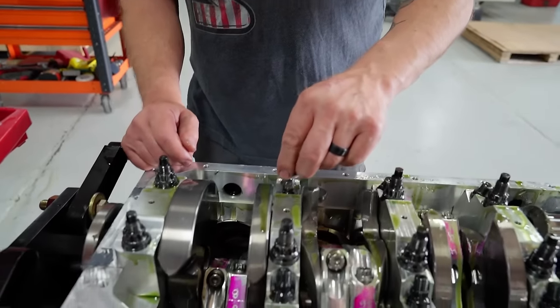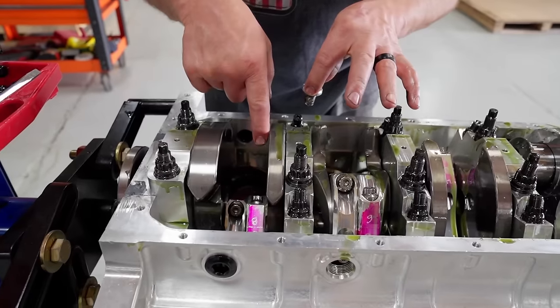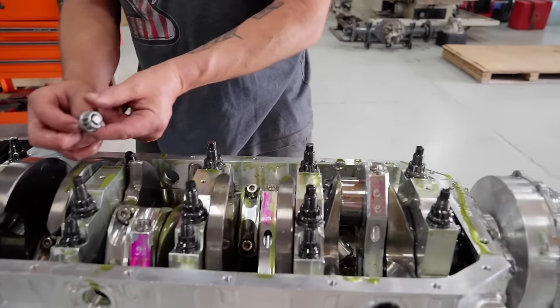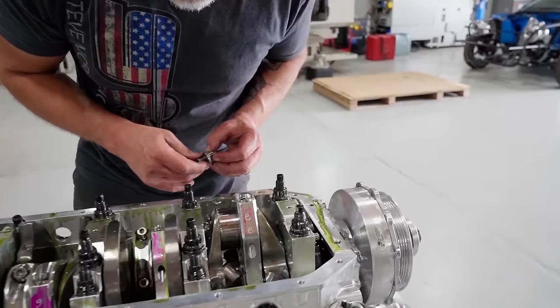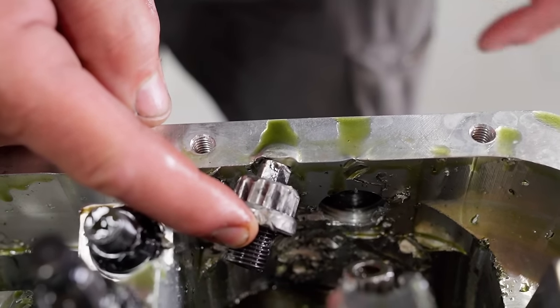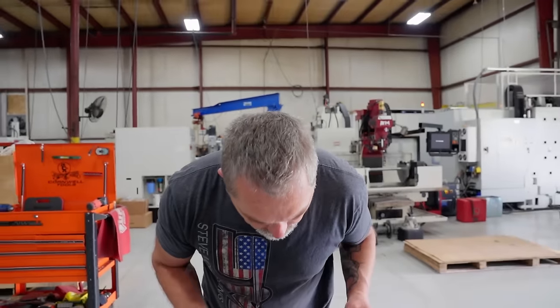But when this broke, very interesting that it didn't destroy stuff back here. It actually moved forward. So that's telling me that it probably did the burnout, and when I hit the brake, you stop after the burnout, it goes forward, whoosh, boom, boom, boom, boom, boom, boom. And literally there is one spot in here in particular where it just fits right there in the pocket. Well, where is that aiming at? It's aiming directly at that connecting rod and the bolt. Not a connecting rod problem.